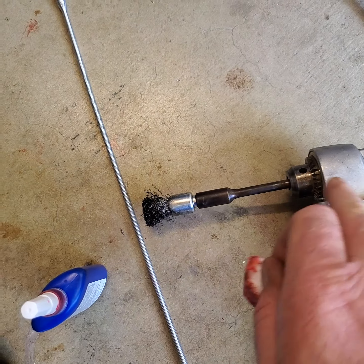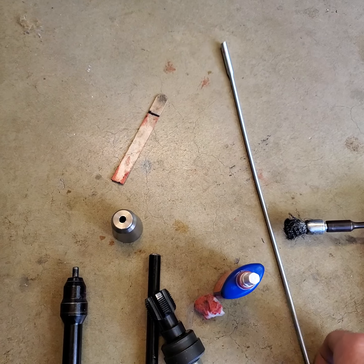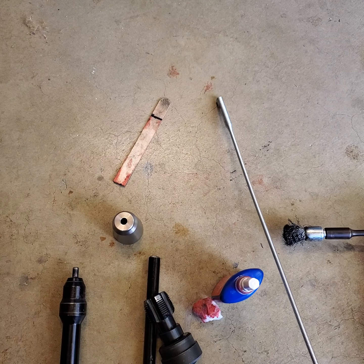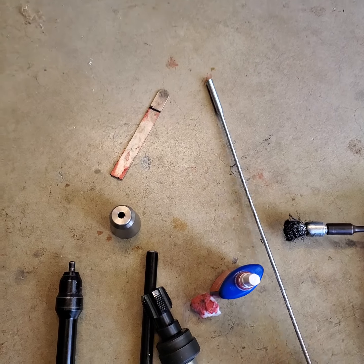3/4 inch extender angle drill, just work it and work it until it's gone. All right, then go down the hole with a rag or whatever, and lacquer thinner is what I use, and I clean all the grease or residual or coolant or whatever's in there. I clean it out, twist it around, get it all real clean.